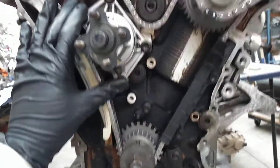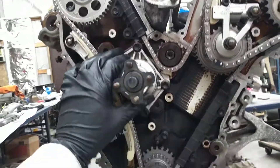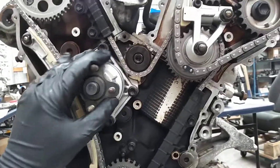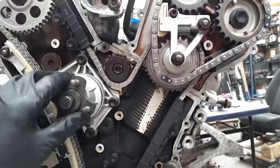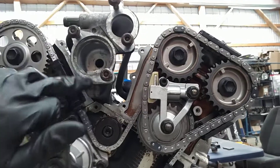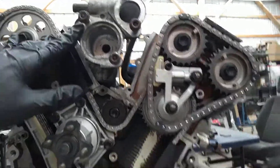The water pump — if you ever have to do one — is located behind the timing cover. You've got to pull the timing cover to get to it. It's right here, kind of sucks, but it is what it is. And here's your coolant inlet and outlet, and your thermostat goes on this one right here.